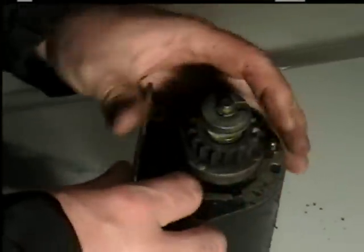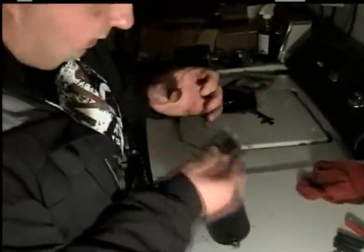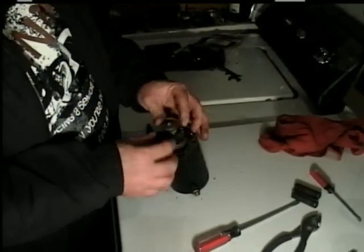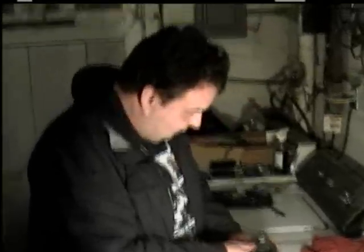When you drive it on there, make sure you don't do a couple of things: don't hit it hard enough to break your tool — it's expensive and has slots that could shatter. Be careful not to break that plastic piece either, or damage your socket. And don't go too deep over your shaft because you could bend the shaft, damage the starter, drive something out the bottom, or bust something. So use your head as well as the hammer — don't hit too hard, but at the same time, a light tap won't be enough and it'll never go on.